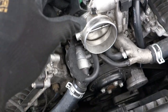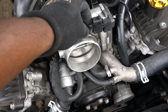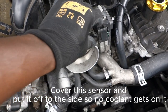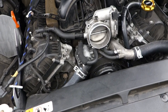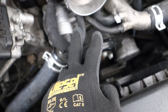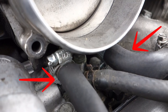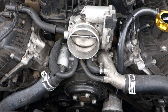You're also going to want to go ahead and unclip the little sensor right here that connects right to the throttle body - don't break it. It's also going to be held into place by a little clamp holder, so remove the clamp and then remove it from the holder and put it off to the side. Once those bolts are off, you'll want to remove these hoses down here below - I believe there are two hoses. I'll take off this last bolt and then get back to you guys when the hoses are removed.